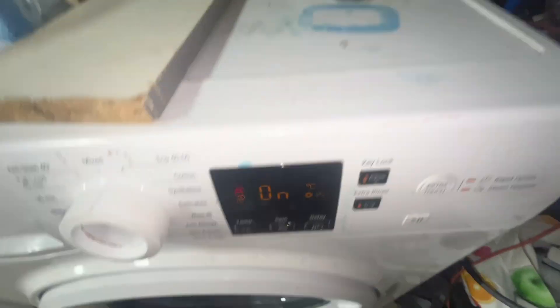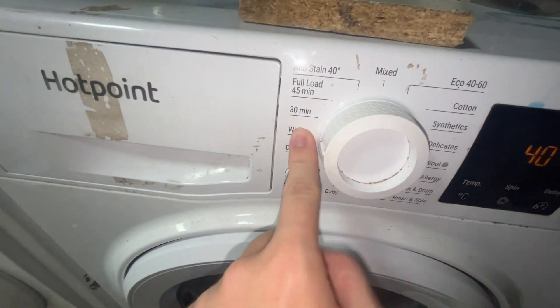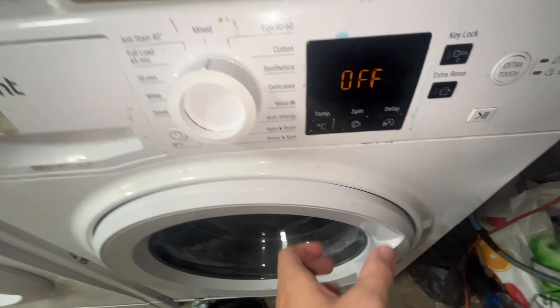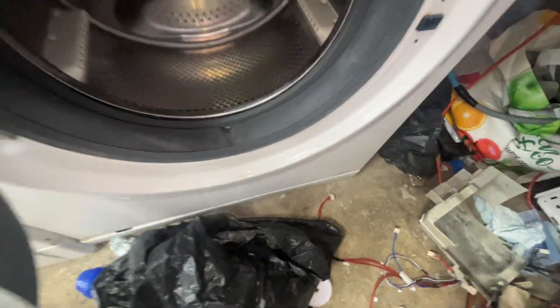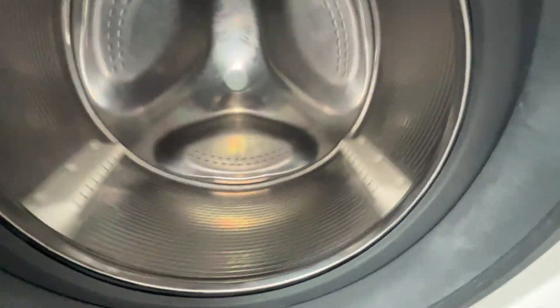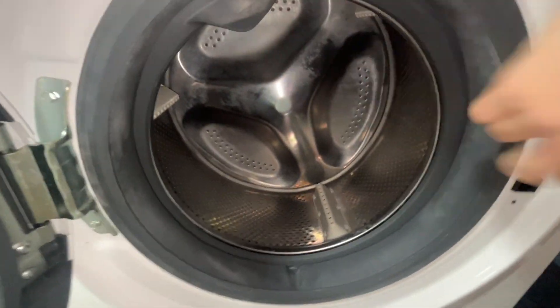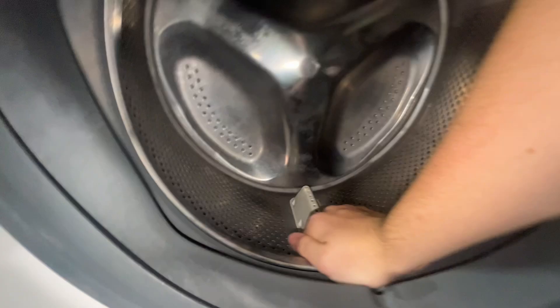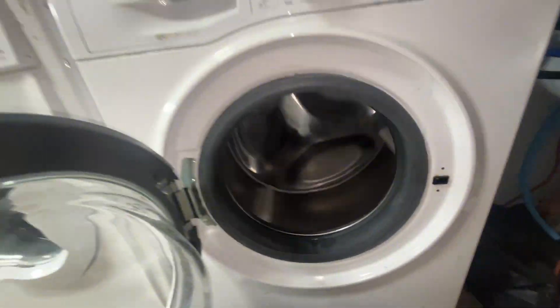This machine does work. I know it's a bit dirty on the outside but I normally use wipes on it. The door's a bit scaly — I need to clean that. The drum's quite scaly as well. The door seal is relatively clean, a bit milky, but at least it's perfectly centred. The bearing seemed to growl a little bit, but there's no play and it's never gotten any worse since I got it. The spider's all good.